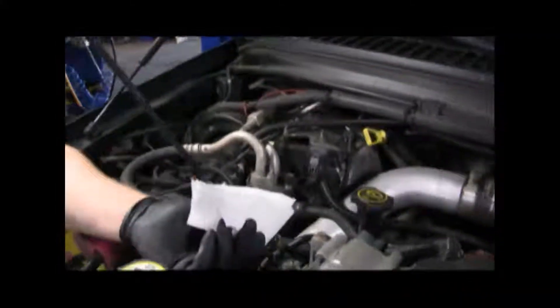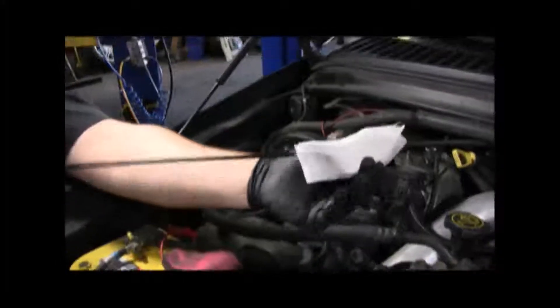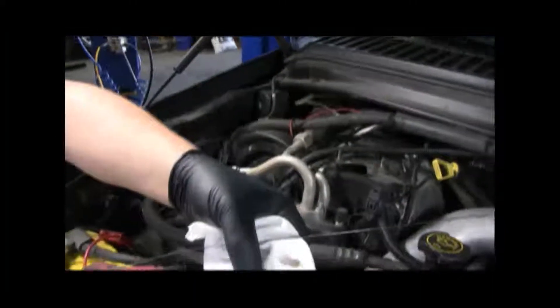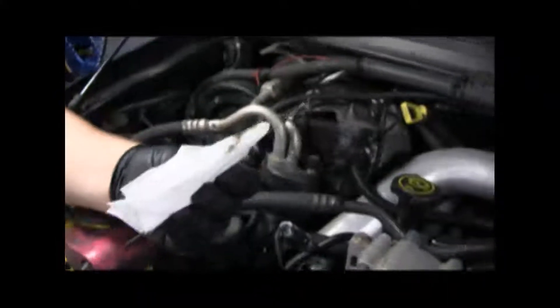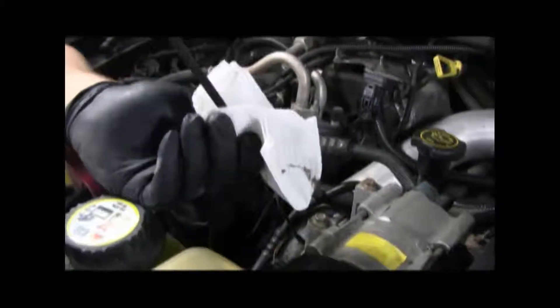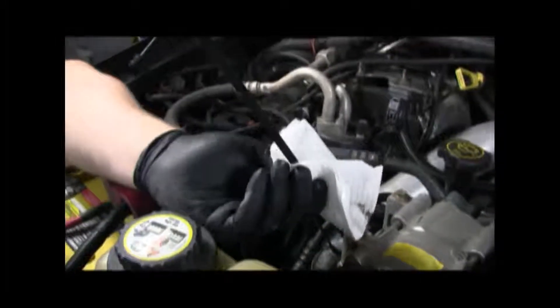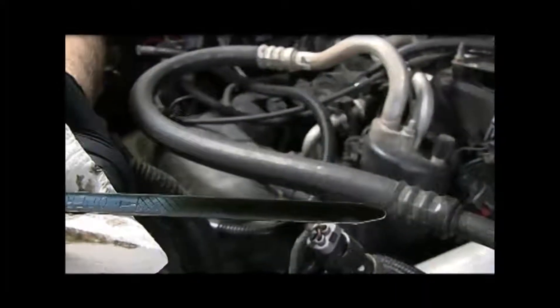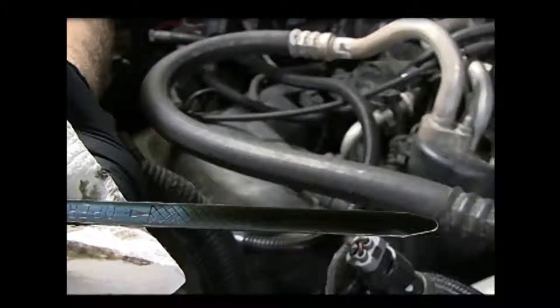Moving on to engine oil — we'll go ahead and pull the dipstick. The first time you pull the dipstick, it's a good idea to wipe it down and ignore that reading, because there's going to be a lot of extra oil splashed up on it. This is a good time to check the color of the oil. As you can see, this oil is getting close to completely used up — nice and dirty, but still has some life to it. We don't want to go all the way until it's useless. After reinserting, we can get a clean reading, and it's just a little bit low — one more opportunity to check if we're leaking or burning any oil.